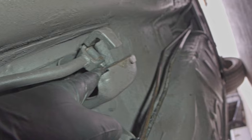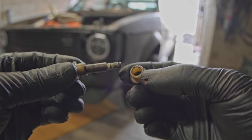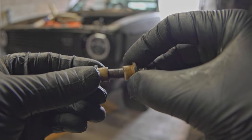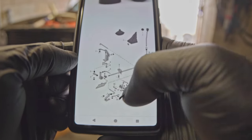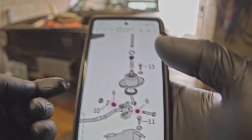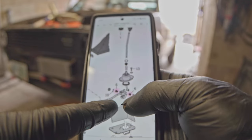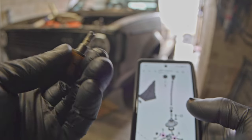Well, here are our culprits. This is that bolt that went through, and there are these little bushings that go in between one part of the yoke and the center. As you can see, these bushings are not doing too hot — this one especially is really bad. So here we go — two new bushings to replace these two. This is obviously your shifter inside the passenger compartment, and right about here is what we just looked at upside down in the camera. So I'm gonna go ahead and order those new bushings — they'll probably just slap right in. If you have shifter slop and you're having trouble getting into first or second, you might want to look at this. It's quite literally one bolt and two bushings.